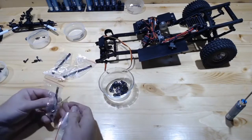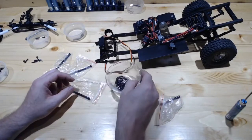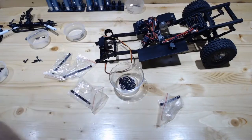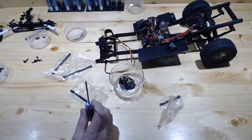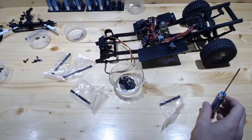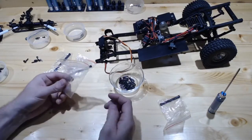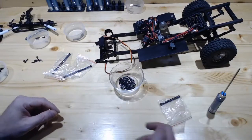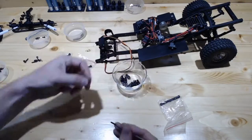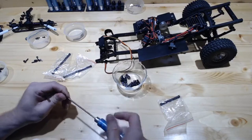We've got our two lowers, the Panhard, and the upper. We designed the kit to use the longer rod ends for the uppers and lowers. These are Traxxas 1942 rod ends. The uppers and lowers are going to use the long ones. The Panhard we designed to use the short. So when you buy the kit, if you pick up the Traxxas rod ends that are on the product page, you will actually have plenty extra — probably actually have enough to do a rear four-link. And yes, we are working on that as well, just need to make the correct length links. Regarding USPS — I think people give them a bad rap. We've mailed like 17,000 packages and I've had less than five that actually were lost.